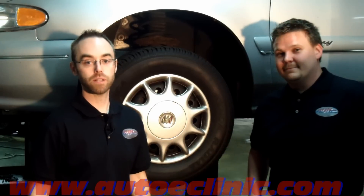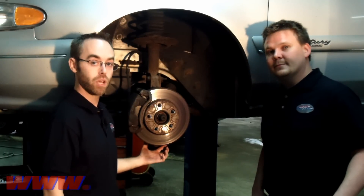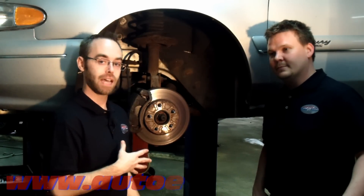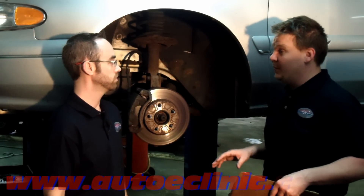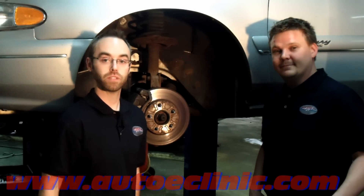Let's take the wheel off and do a visual inspection as well. Since the wheel bearing is a sealed assembly, visually we can't tell if it's bad or not. But after the visual inspection, we did notice that the CV boot was busted on the outboard boot. This will allow water and contamination to get inside the joint and damage it, causing it to go bad or fail. If we can get the approval on the wheel bearing, we can go ahead and replace the axle while we're there and save the customer quite a bit of money on labor — we're going to be there anyway. Let's go find Chris, tell him what we found, and see what he wants to do.